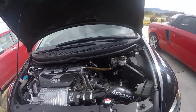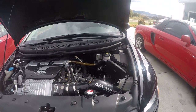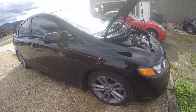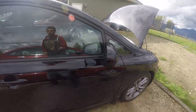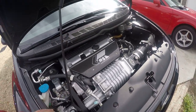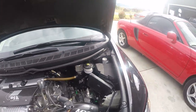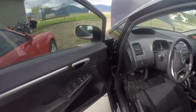The car is at about 294-295 horsepower at the wheels, which equals about 330 horsepower at the motor. That's a good amount for this car. In the future I might do a smaller pulley and add an intercooler for the supercharger, which will give me a decent amount more boost and a bit more power.